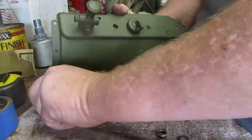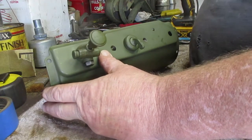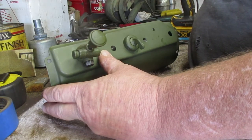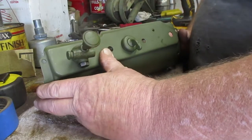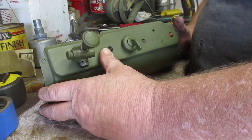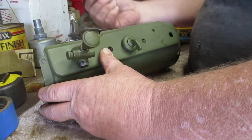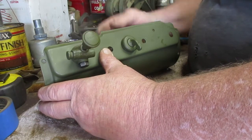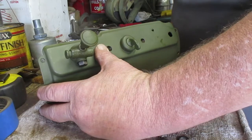And the first pull, what that will do is it will close the circuit from the battery, the generator, and the electrical system. It'll close the circuit inside the switch and allow electricity to flow to the service brake light, which is only on the driver's side of the truck. When you push the brake pedal to the floor, you close the switch through hydraulic pressure in the master cylinder, and that closes the circuit back to the service stop lamp, and the red light will illuminate.